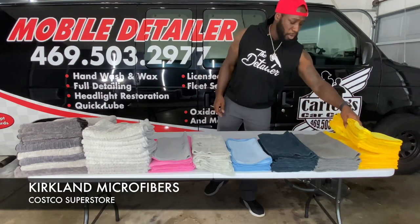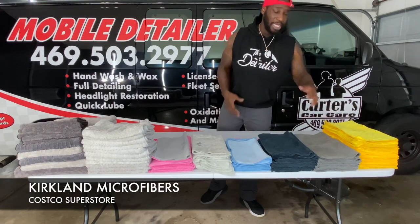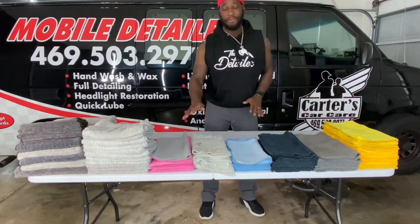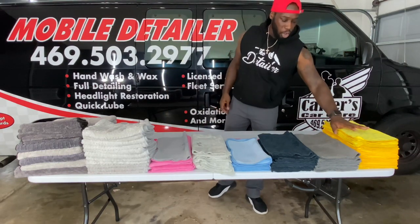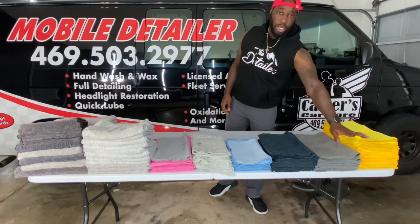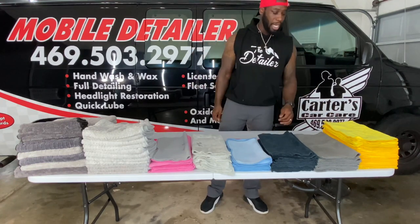This is the multi-purpose towel. I don't use this to wipe off waxes. I don't use this for removing coatings. That's just me. I know some people who do use these for coatings. I used to, until I found out about these other towels. So I veered away from using these for removing coatings because I started to find that sometimes it would still leave a little micro marring in the paint, and I didn't like that.